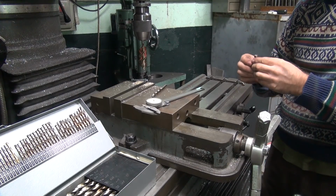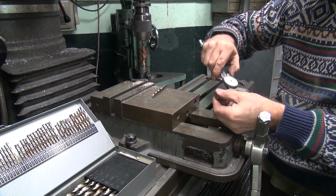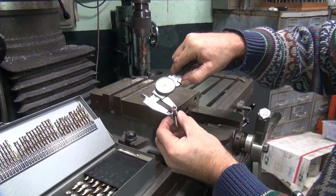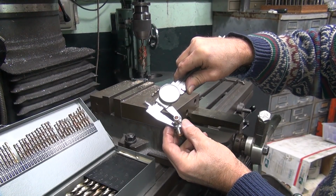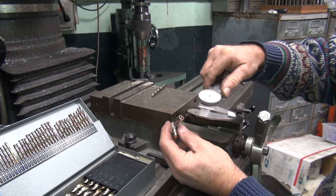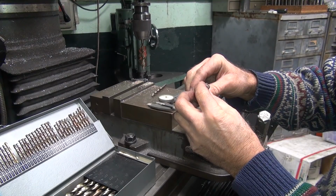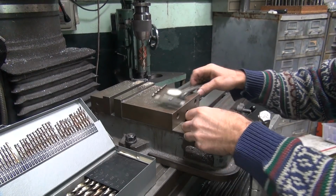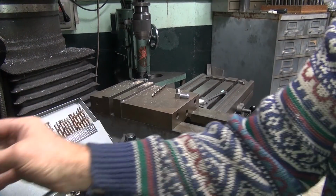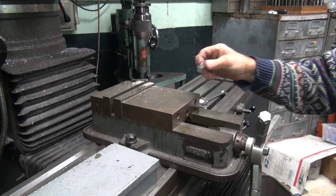Big improvements. So that's where we're at right now. I think it's safe to go one more size. 15 more would put it right over here. It'd still be 50 thou, 25 wall. I think we're pushing enough. Those other fittings are not nearly as thin through here. Those S&S fittings are thicker, so you can cut things bigger without being a problem. Right now we're good, 60, so that's 30 wall at least. So I can give them that.